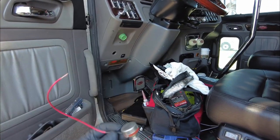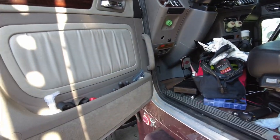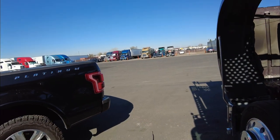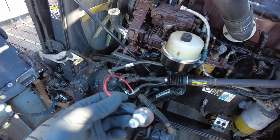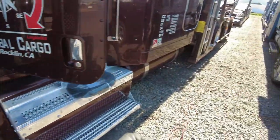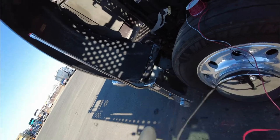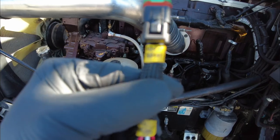The second piece plugs between the boost pressure sensor. What you've got is basically this little switch — you can put it anywhere inside the cab, wherever you want. It's got 10 positions, you just adjust it the way you want. Zero means nothing changes; turn it up to 10 and it'll give you some extra boost.